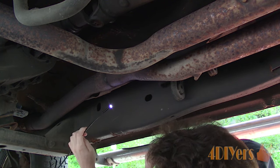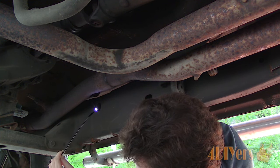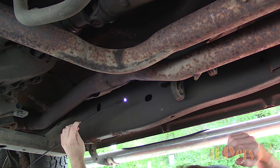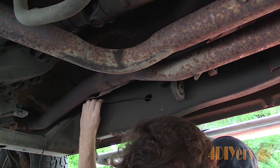And finally I would recommend using a borescope — there are various products on the market and this one I have recently reviewed. You may have noticed those factory holes while inspecting the frame; this is a great way to view inside. Here we can see the interior condition. The frames on Toyotas, while they may look good from the outside, are known to rust from the inside out. The tube frames do tend to trap more road debris as mentioned, and not all frames are equipped with large enough drain holes. Even if the frame looks perfect from the outside, inspecting the inside can show any previous repairs, bubbling, excessive scale, or any other damage which may jeopardize the structural integrity.